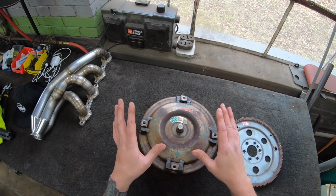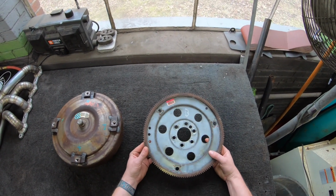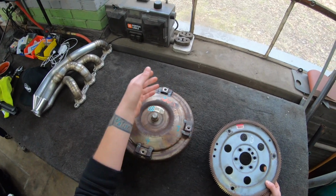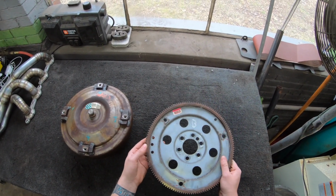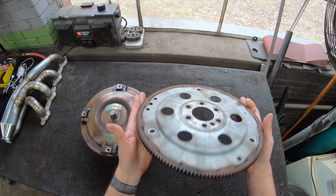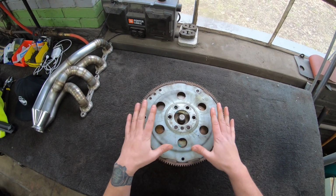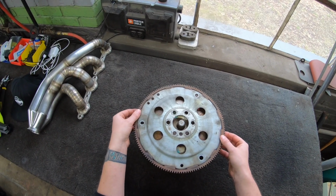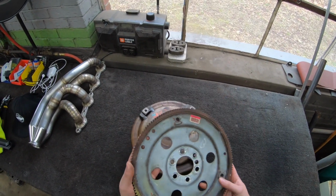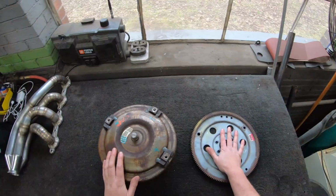Now, while you don't need to make any modifications to the 4T80 converter, you do need to modify the LS4 flex plate. The 4T65 uses a 3-bolt pattern on the converter, where the 4T80 obviously uses 4 mounting pads. So any competent machine shop can take your stock flex plate, index this pattern, and drill it on here. There's plenty of material. I've done it multiple times and it works fine. Your only other option would be to consult a company like Mizir and have them do a one-off flex plate. Obviously that gets pretty expensive. I might offer something down the road, but right now I don't have any plans to. I have re-drilled plenty of these for customers. But that covers things you need to take into account with the converter.